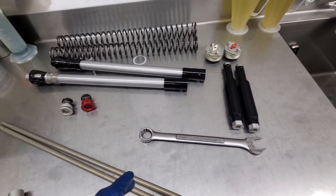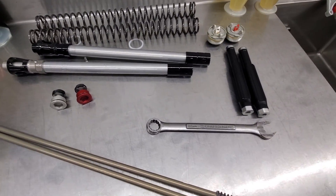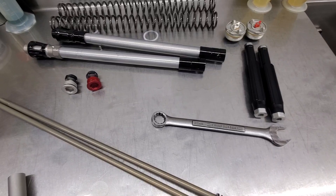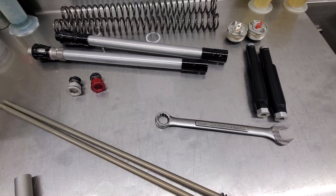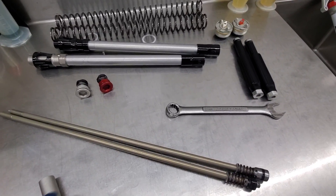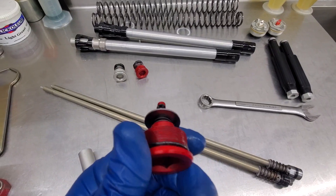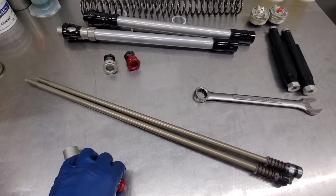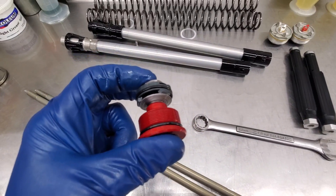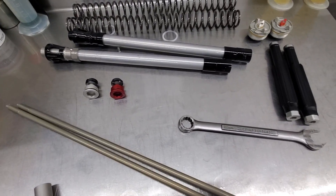Going to changes beyond the spring guide: we see various valving combinations here from the first rendition in 2017 throughout the different manufacturers. Even though it's still all WP stuff, there's lots of different valving and shim stacks between the models. Here's a couple older ones and some of the newer ones — considerably different in thickness, diameter, and the amount of shims as well.